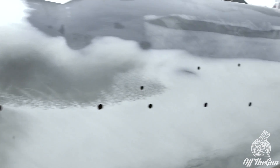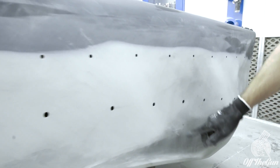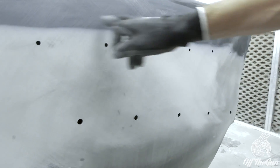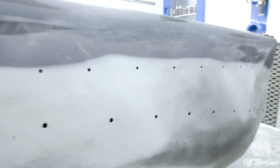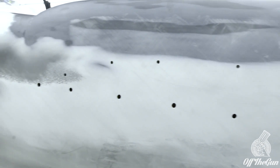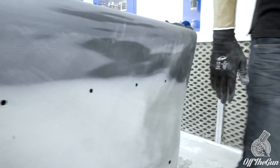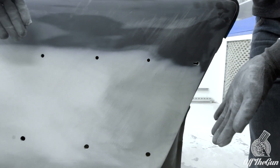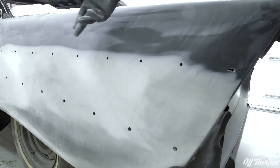It's rubbed out really nice down through the rear quarter over the rear arch. And you can see real obvious that the rear portion of this quarter — there's a large area there which still has guide coat on it; the spline hasn't touched it. So that's going to rub up as a low, which ultimately is going to be a slight ripple through the rear quarter. Just keep working that in and get it all smooth. As we get down right towards the rear of this quarter, that last portion — the curvature accelerates in, so you don't need to rub it there. You can step down to a thinner spline to finish off that back portion.